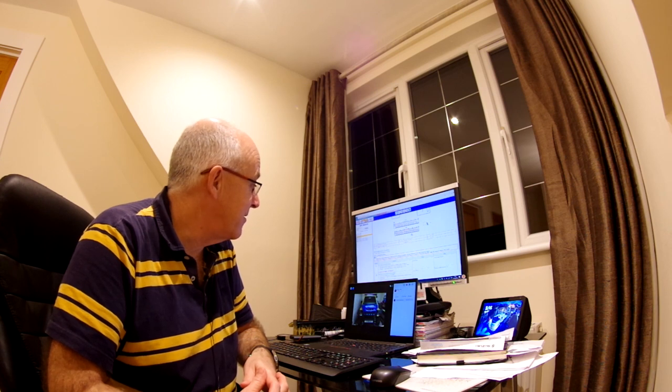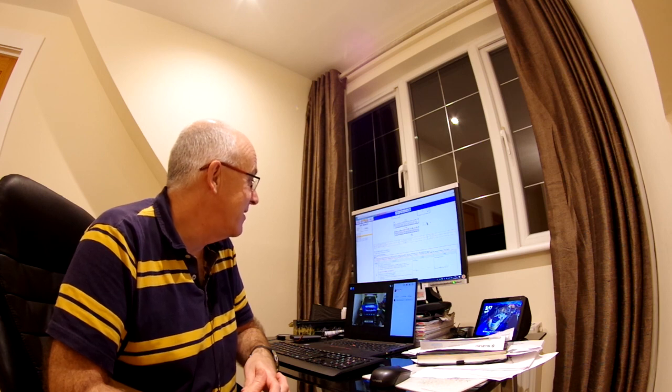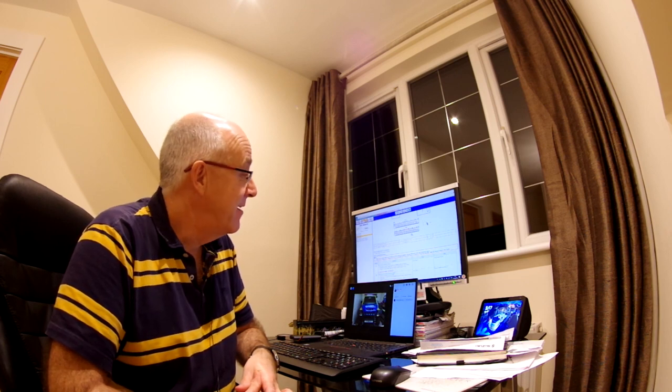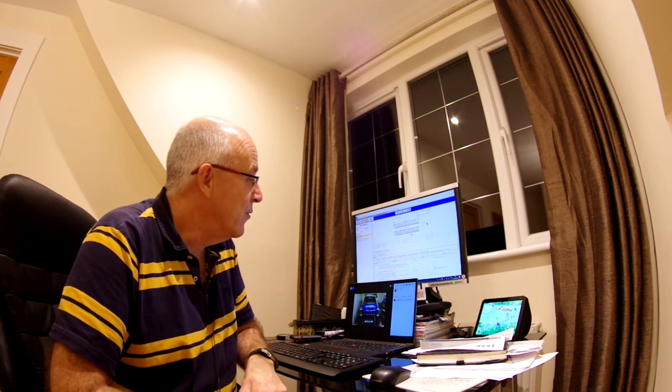As a quick postscript to the video, I had it pointed out that the code is actually well known. That fault code on our Gen 4 is a well known fault code, in which the sun sensor says that it's got a high load on it. It turns out that it's because of LED lighting in my garage. LED or fluorescent lighting in a garage gives the sensor error because it expects sunlight or incandescent light, so a standard bulb, otherwise it throws an error code. So it was very simple, very straightforward, and I really should have realized it. So that's what that error code was.